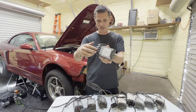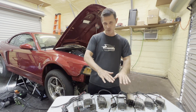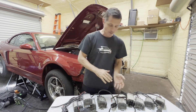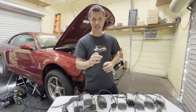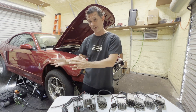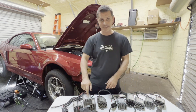The other advantage is you can control the speed. We're going to feed it a PWM signal from the Megasquirt and it'll tell the controller how fast or slow to spin the fans. We'll set up tables based on engine coolant and intercooler coolant for the heat exchangers, and the fan will basically ramp up with the coolant, reaching an equilibrium where the fluid stays at a constant temp. No more snapping on full power then off — these fans are going to work great and you're never going to hear them again.